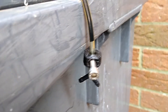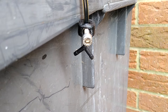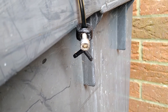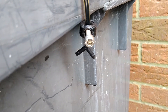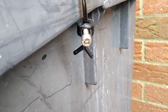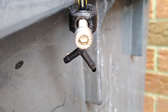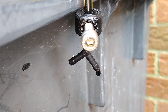As long as the oil runs down both legs of the Y — I'm not too sure what I can do about it if it decides that one leg is easier than the other and just drips out of one hole. The other thing I did think about is having some sort of material pad that rubs against the chain and the oil is delivered to the pad — that may be something I might have to look at. I'll see how it goes with the Y first. You've got oil down as far as the Y junction — are we going to see any drops soon? The excitement is unbearable. I suspect it's just dripping out of one hole. It's actually probably coming out faster than needed.